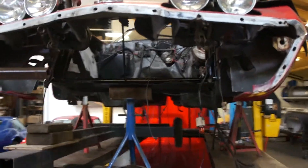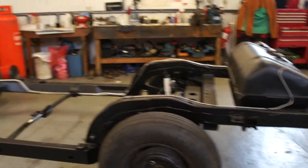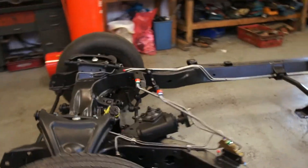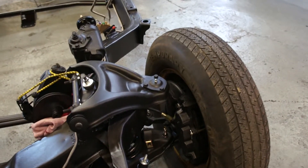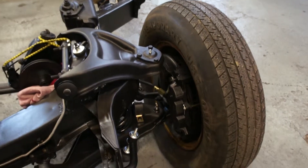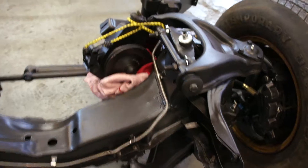I'll just show you the chassis. That's all assembled and back together now and looking very, very good. New fuel lines on, new brake lines on, all new suspension. Reused your calipers but with new flexes and new brake lines. We've stuck with your pads — we want to disturb the calipers as little as possible really.